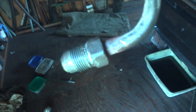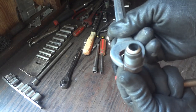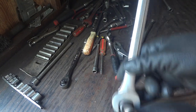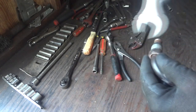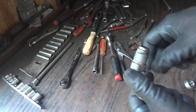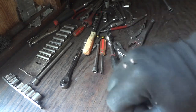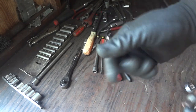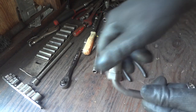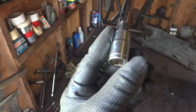You can probably use a crow's foot ratchet on there — if you know what I'm talking about. Let's see what size this is so you'll know. This is a 7/8 — yep, that's what it is, old 7/8. So that's what you'll need. Get a crow's foot ratchet wrench on there and put your socket in there. This gives you more room in there because the back of my ratchet was hitting part of the frame, so I can only go so far. Once you get that out, you've got it made.